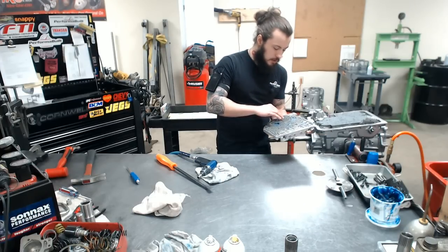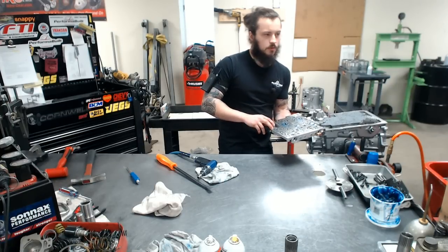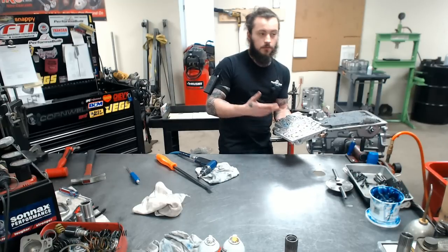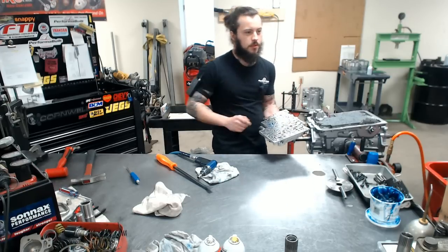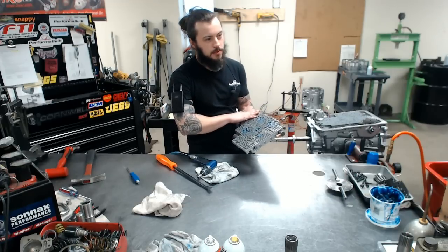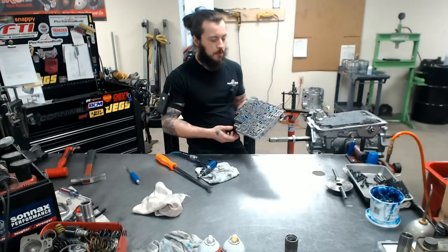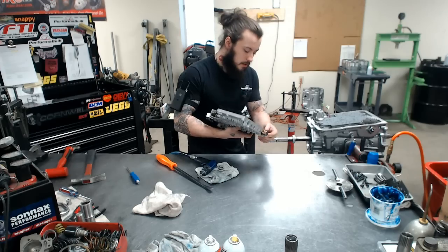It's important to clean your valves, you know, take this thing apart. Solenoids, if you're going to reuse them, test them at the very least. If not, install new ones. If you're reusing them, use O-rings and metal pistons for forward, second, and fourth. That's important. The plastic ones that are originally in it usually crack, or the heat shrinks them and they just never work right. It was a horrible idea. So, other than that, a couple of the basics there.